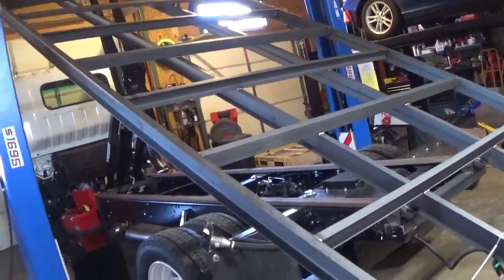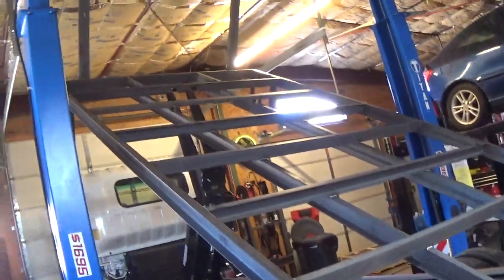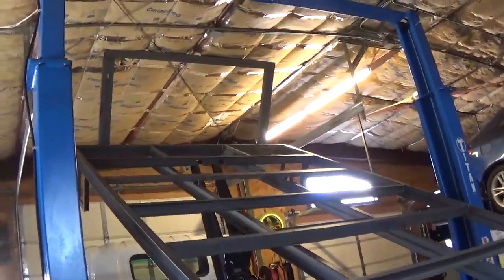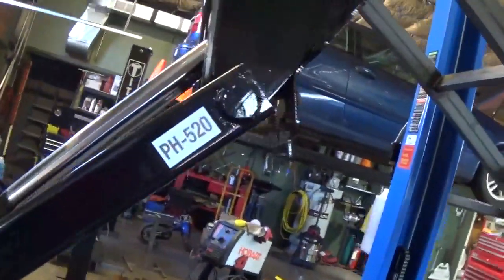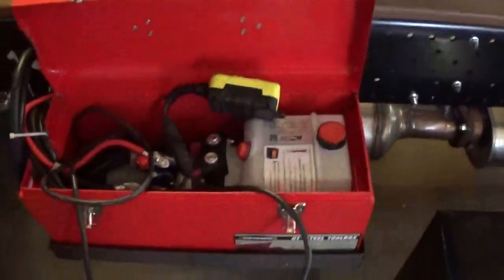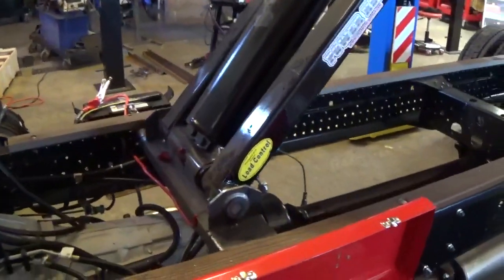The overall bed is 18 feet and I'm at about a 30-degree angle — I don't want to go much more to prevent stuff from sliding off to the side. The equipment we're delivering is 16–17 feet long, a couple feet wide, and weighs 3,000 pounds. We'll put a winch on the very front, slowly winch it off until it hits the ground, pull the truck forward, and winch down at the same time. The PH 520 kit runs around $1,400–$1,500 depending on where you get it, and you do need to grease it once in a while.